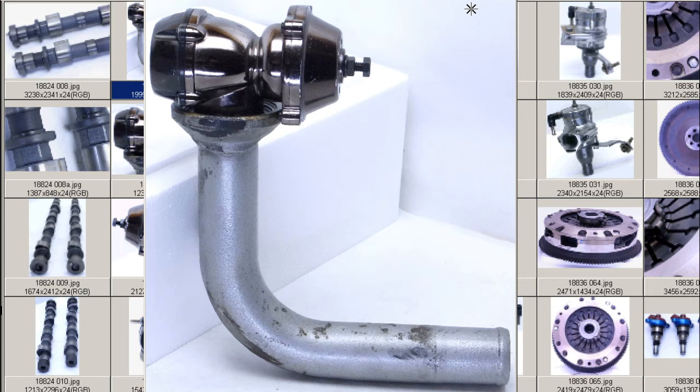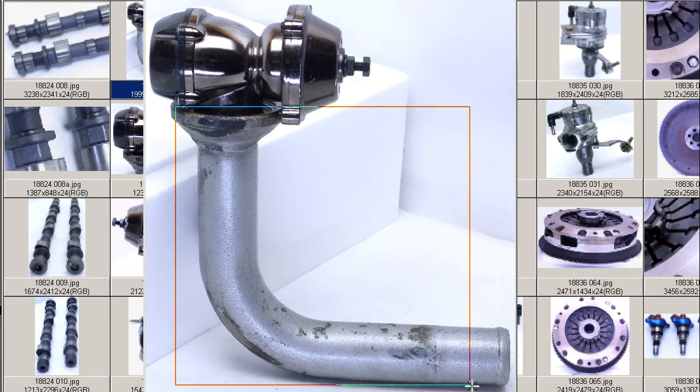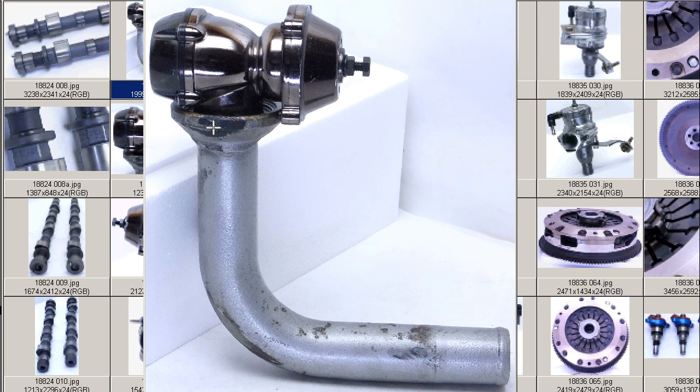Z16A series. Of course, three different vehicles were sold in that series. The Zenki, Chuki, Koki is removed from a Zenki twin turbo, so a twin turbo, 6-speed manual transmission, 4-wheel drive, of course, and the 6G72 turbo engine. So the flange is specific for the GTO, but the valve itself is a universal and adjustable blow-off valve with adjustable tensioning to the spring in the back here, but the flange itself is for the GTO, and in particular the Z16A GTO, and removed from a 1993 vehicle.